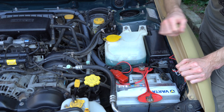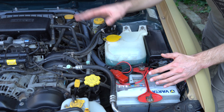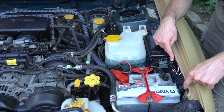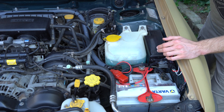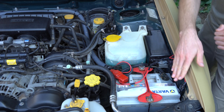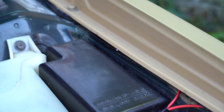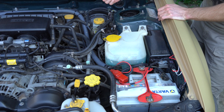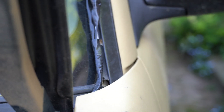So what do we have here? First of all, the battery. This is my main battery which is a 63 amps per hour — a pretty small one, because I also have a pretty small petrol engine. You're directly gonna notice here along the fender a relay and an inline fuse. That is actually the harness for my light bar. I really wanted something totally independent from the original harness of the car, because most of the time you end up with problems if you touch the harness. So independent wiring directly hooked up to the main battery for the light bar, going along the fender, then through the firewall to my dashboard for the switch, and another cable all the way up along the windshield directly connected to the light bar.